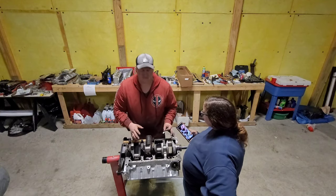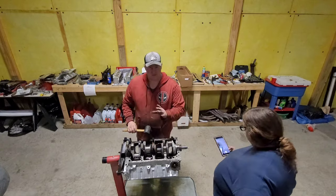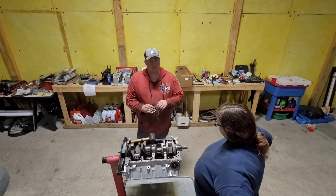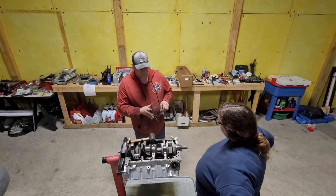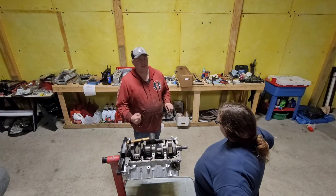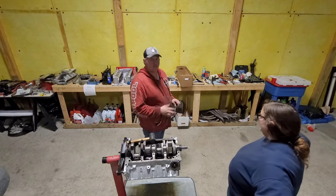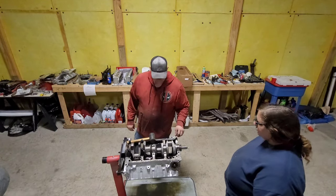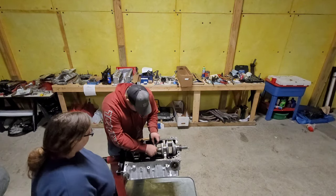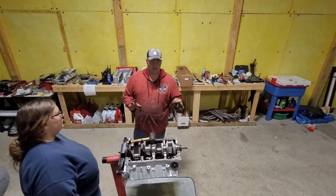Nope. Again, right on 20 thou. Great. Starting to look really good. Now remember, these are your good bearings. You don't wanna booger them up, don't drop them. Be gentle, you know. I know you're in a rush, you wanna get your stroker going. Messed up a bearing last time, not this time. All right, cross your fingers. Keep knocking on wood there for me, buddy. Again, beautiful. We are right at 20 thou.